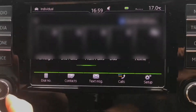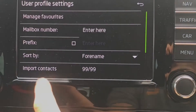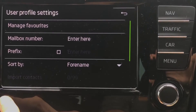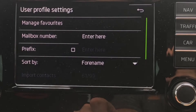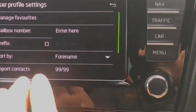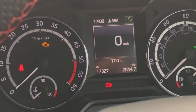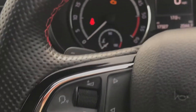Now what would happen is if you're in your phone section, you would go to set up, then to user profile and import contacts. It says 99 of 99 because I've now fixed it, but before when I would press import contacts it would just say failure to import contacts. You need to go into your Bluetooth settings in your iPhone settings to allow syncing of your contacts — only then it will work and allow you to call home.